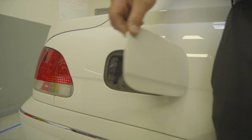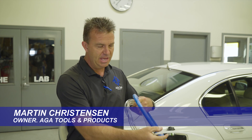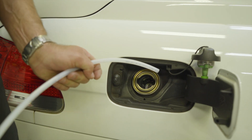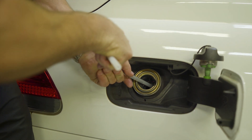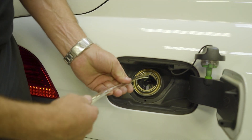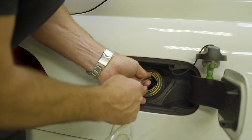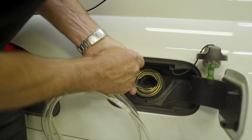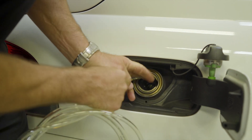The problem is you have to get fuel out of the vehicle. If you've been working on cars for a while, you've probably tried any combination of these: a very stiff hose, a very soft hose, and or maybe a rubber hose. The problem is these are very difficult to use. The stiff hose makes it past the filler flap no problem, but when you hit the first turn you can't push it past. The soft hose also makes it past the flap, but once you get one or two turns past it, it just starts to bunch up and becomes very difficult to push down into the tank.